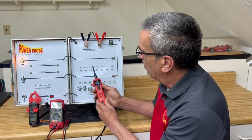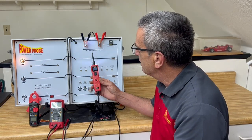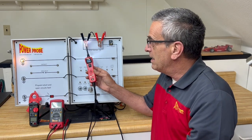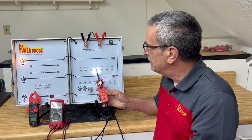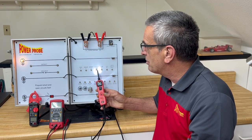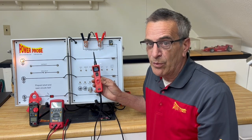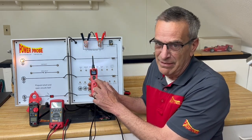You can power up components in your hand by applying ground on one side and power on the other. And that's not all the PowerProbe can do. Just the fact that it's connected to the battery and is always comparing readings to the battery it's connected to. When using the PowerProbe, you should normally get red light, high tone on positive, and green light, low tone on ground. It's always comparing from the battery it started with. If it sees a difference of more than half a volt — here I'm reading only 10.2 volts versus 11.8 up here — you won't get that light and tone. So it alerts you that there's voltage drop on the circuit. It's especially effective when testing the ground side because it's always comparing to the ground side too. So the PowerProbe 3 can still be a very efficient, effective circuit tester even if it did not have the ability to apply power or ground.